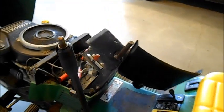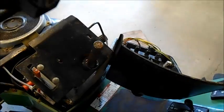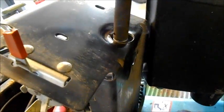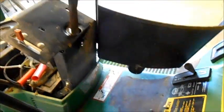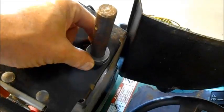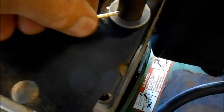Okay, BTHV1, we're back working on the tractor and I've got the steering column pulled apart. When you used to steer the tractor, this steering wheel would bounce around like this. So I took the steering wheel off and I found this bushing, which is supposed to sit in there like that — it was actually under this. There's supposed to be something through that hole, like a cotter pin, to hold that from popping out.